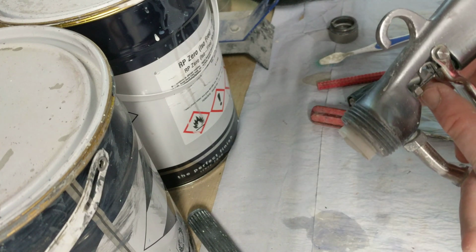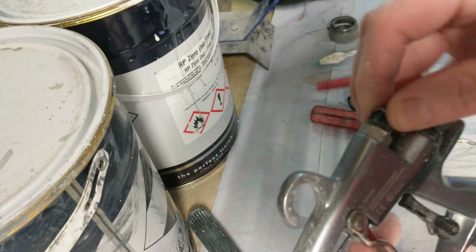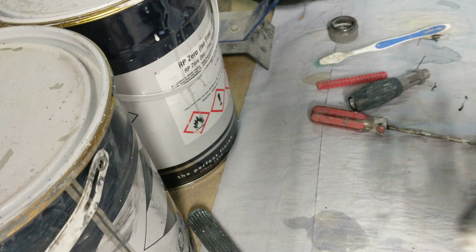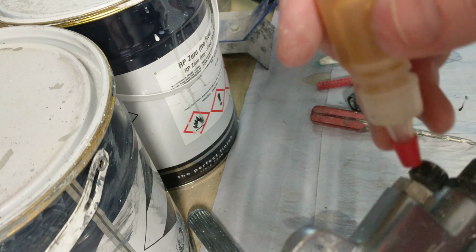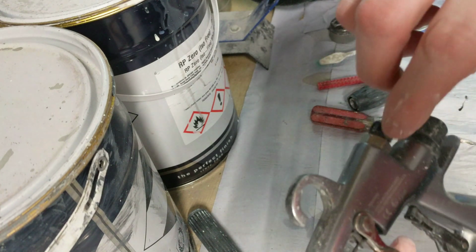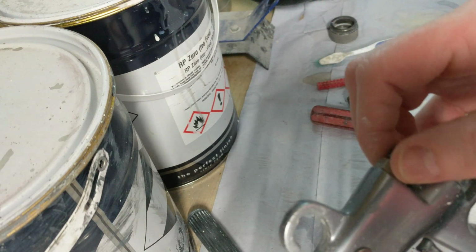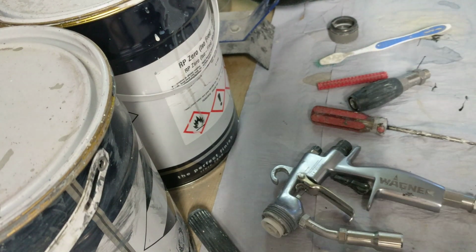But particularly these with the paint build up on them, keep your needle oiled, and also in there, I always keep oil in there. I know it's plastic in there, it's supposed to be self-lubricated, but if you get the oil in there, where's it gone? If you get the oil in there and let it run in, it just runs into there a bit, and it stops paint building on there, which can then start and restrict that. But again, that's dead simple. You nut on there, it's on a circlip, it's very easy to do. But that's it, just a quick one that is.